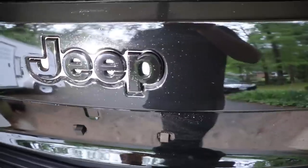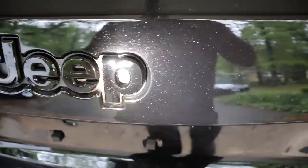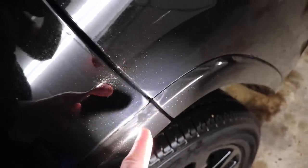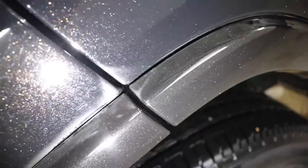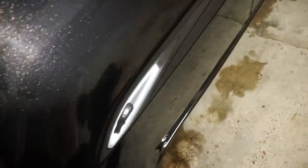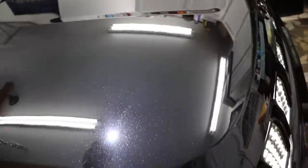You have the black gloss lettering and plastic in between — we want the faces to look as good as possible, but there's a little scratching there so we'll tread carefully because the clear coat can be very thin. I noticed one other little weird spot in this corner — almost looks like burn-through, maybe someone at the dealer did something. It feels a little rough and dry, so we're going to tread very carefully around that area. Overall there's not a ton of heavy defects, just weird marks here and there — nothing we can't handle or at least improve upon.